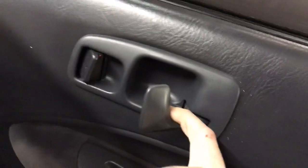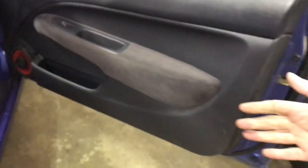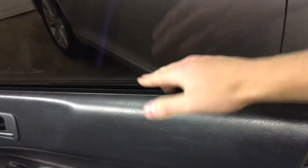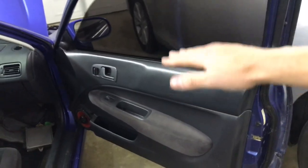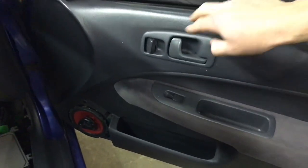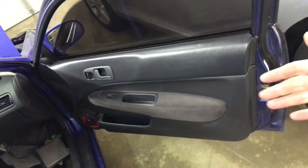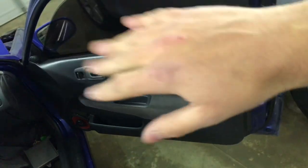I'm going to show you guys the window regulators. I hope you guys enjoy it. So you've got a screw behind the door handle, up there in the corner — that needs to come out. There's a screw right there, and then you've got to remove the speaker as well. Once you get that removed, you can pop the door panel out, and then you lift the door panel up because there's a lip right here that's going to keep the door panel seated onto the door. Really easy: remove the speaker, remove the door handle, remove the door pull. These both need to come completely out as well as the speaker. Then you can use a large screwdriver or trim tools, pop the clips out, lift the panel out, and get it out of the car.